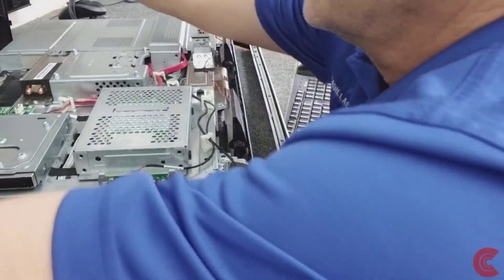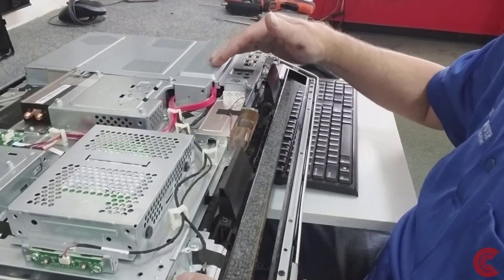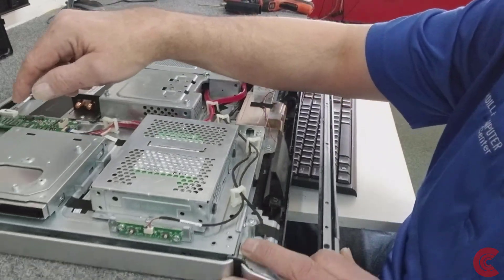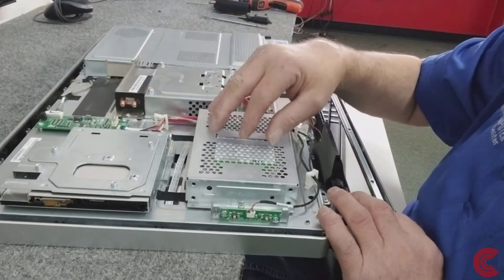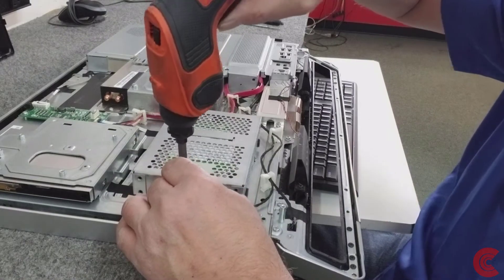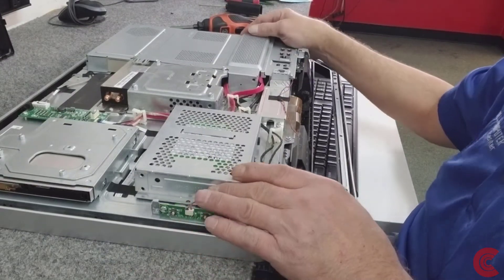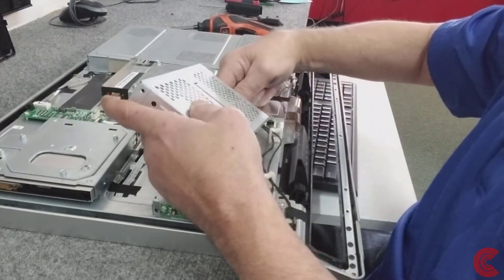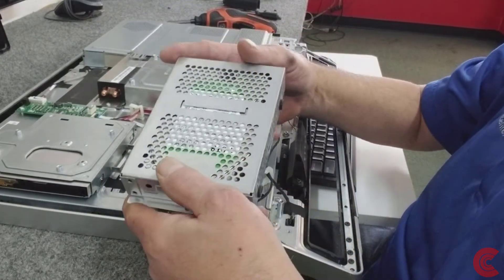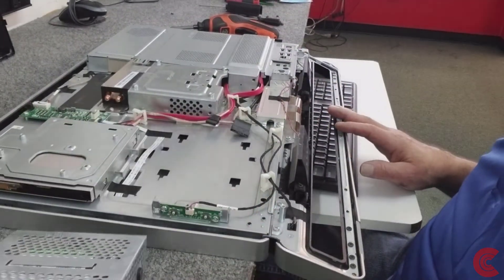Our hard drive is right here. You can remove this panel over here — the motherboard is under here. I've replaced these motherboards a few times, not too difficult. You've got your optical CD tray here, and the hard drive is under here — it's a three-and-a-half inch drive. To remove it there's one screw right down here you have to take out, and it slides back just like that. We're going to disconnect it — the SATA cable and power cable. And here is the hard drive. Just take out the screws on the side and you can put a new solid state drive in there, which I'm going to do.